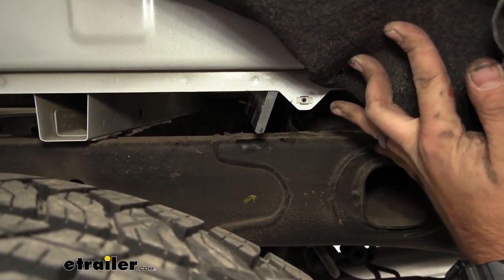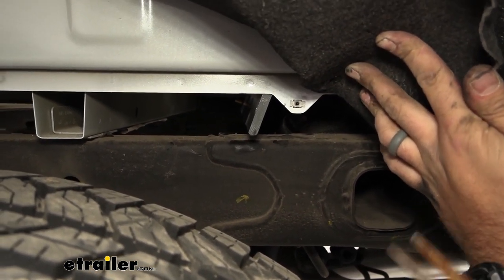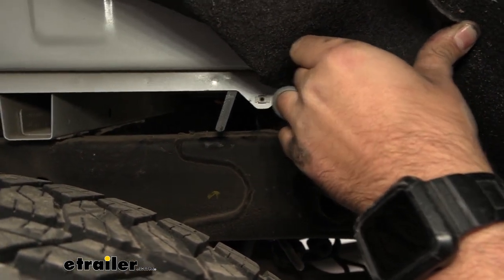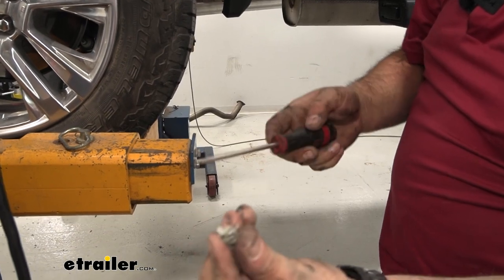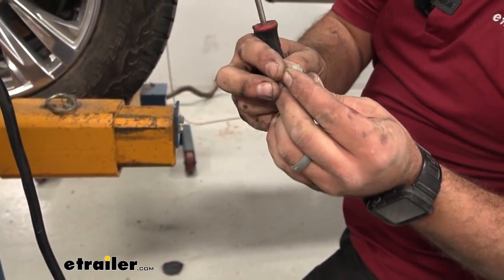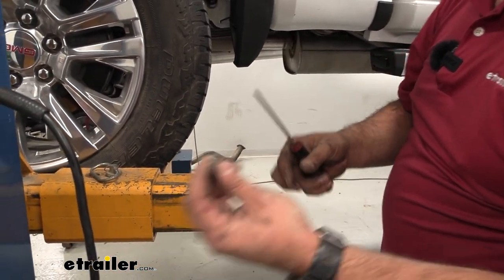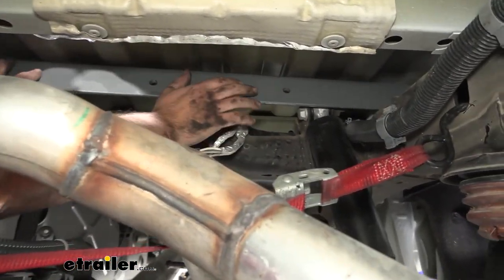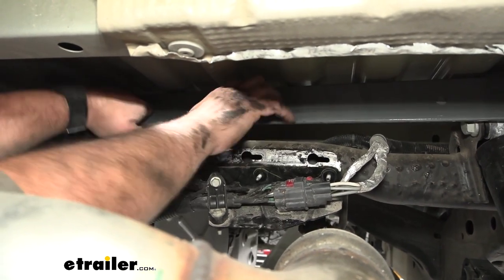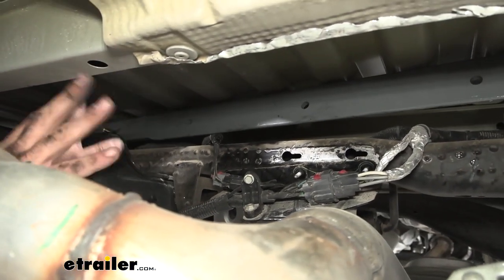When pushing back I see why those retainer clips need to be removed — they catch on the crossmember. You can pinch them with pliers or use a small flathead screwdriver on the lip to pop them out. Once removed, push this against the shock mount, then push the other side forward to create a little more space for when we put our center section in place — it's going to be a slightly wider opening to clear for the fuel tank.